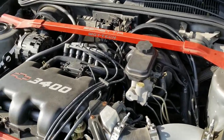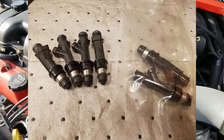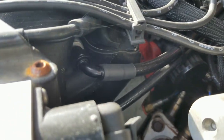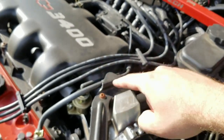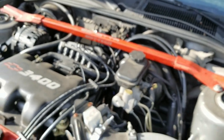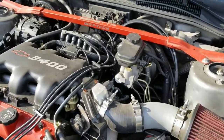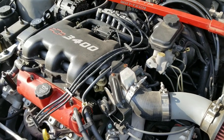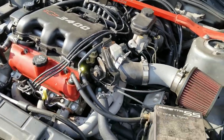The fuel rails — it's got 28 pound-per-hour Trailblazer 4.2-liter fuel injectors. On the fuel rail and fuel lines I ended up welding on fittings, which is a lot cleaner way to run them than the factory setup. From the factory there's a big loop with a steel part that runs back — it's crazy how they have it set up. There was also a captured O-ring in the fuel rail with no way to get it out and it was seeping fuel, so the fix was to eliminate the stock fuel lines and go with dash-6.